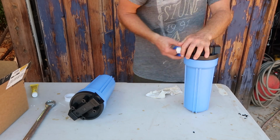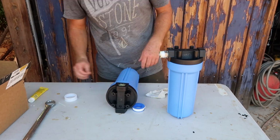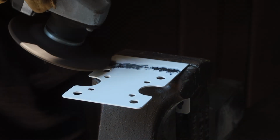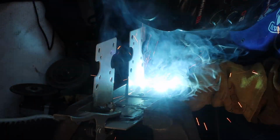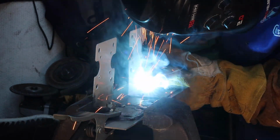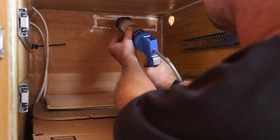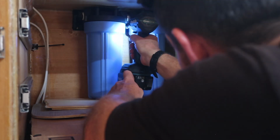The water coming out of the faucet will be filtered. I bought filter housings and filter elements from ClearSource RV and used stainless steel plumbing fittings to connect the housings. Then I built my own mounting bracket. If I had more space, I could have just mounted the housings on cheap standard brackets, but I don't have the space to access the mounting screws once the filter is under the counter. So I made a bracket that I pre-installed on the filter housings, then mounted the entire unit to the wall under the counter with Sikaflex 221 and panhead screws.